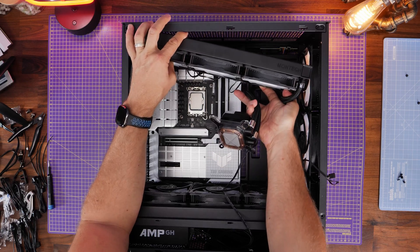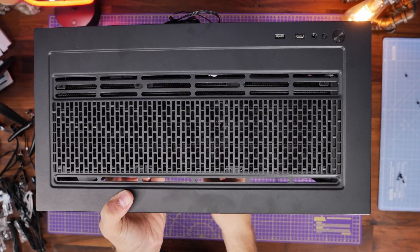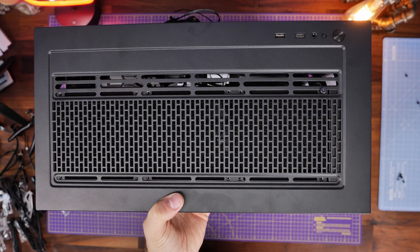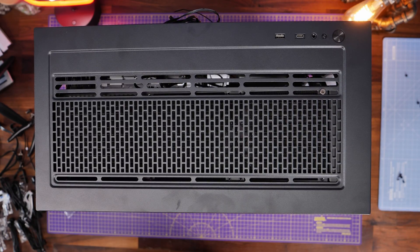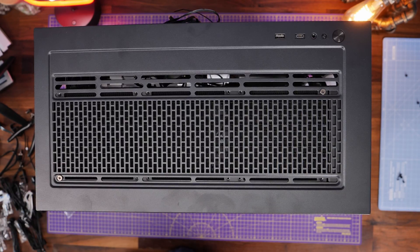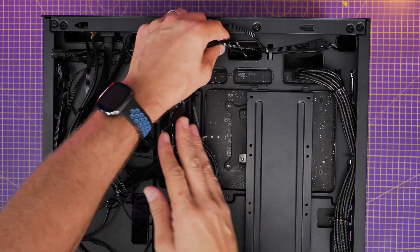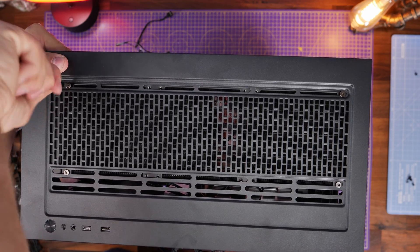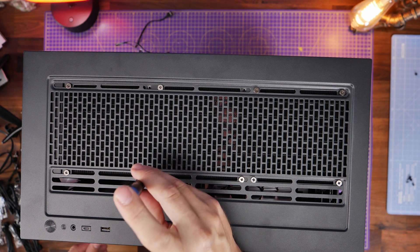The next thing is securing the radiator to the top of the case using those small screws from the tiny bag. I initially only installed two screws first, because it's very easy to accidentally catch the fan cables in the gap between the case and the radiator. So just secure a couple of screws to hold the radiator in place, go about tidying the cables, and then secure the rad fully. You might also want to check the position of the radiator and reposition it slightly before committing to all the screws. Then finish off by installing all the remaining screws to secure it fully.